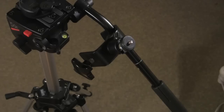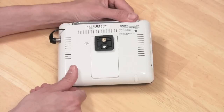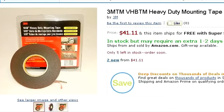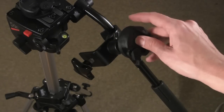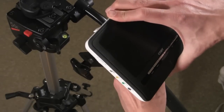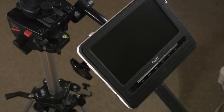Now you've got this quarter-inch screw exposed and you can attach anything to it. But remember, I have a monitor with no quarter-inch thread, so here's how I fixed that: I put one of the Sema quick-connect plates onto the back of the monitor. I removed the screw, the pin, and the spongy pad, and stuck it on with double-stick tape — but this isn't just any double-stick tape. This is Super Mount tape from Radio Shack, also known as 3M VHB tape — Very High Bond — it holds up to a hundred pounds. So let's mount the thing: take the Sema quick-connect base, attach it to the Frugal Clamp's thread, put it in position, hold the spring back, and pop — your monitor snaps right into place. Click it to lock so it doesn't fall off, then loosen the mini ball head and adjust it into any position you like, and lock it down. Congratulations — you just mounted a non-mountable monitor.